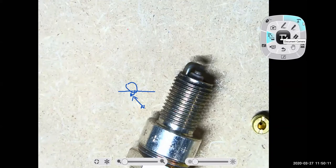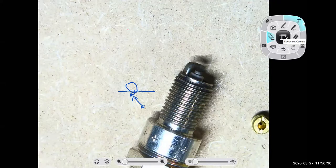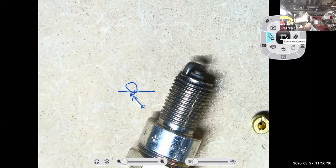Is there a reason why, without getting on the throttle, when I did get it to shift into gear and not die on me, it would just sit at like 20 miles an hour? Or it was staying revved up all the time? No matter what I did before I got on the throttle, it was always cruising around 10 to 20. Maybe something wasn't letting the throttle slide close down all the way.